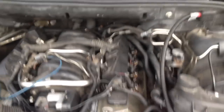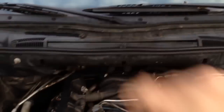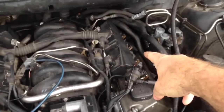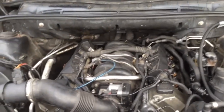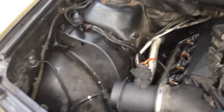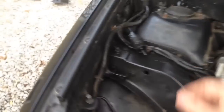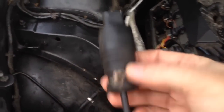We reassembled a few things while waiting on more parts. We put all the cowling back in so there's no water possibly getting down here and I don't have to use cardboard to cover the engine anymore. I was still going to put the air box and washer tank in. This thing had some pumps — one or both were leaking. You can see this one was leaking out the weep hole.